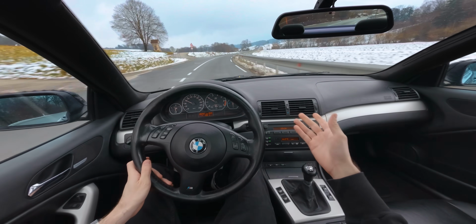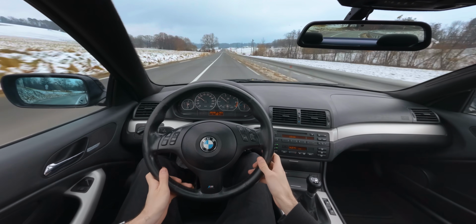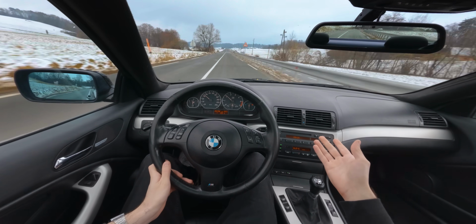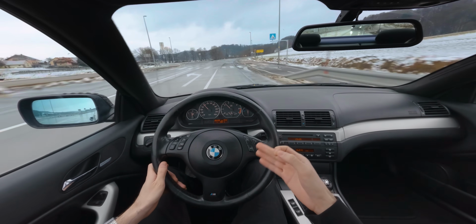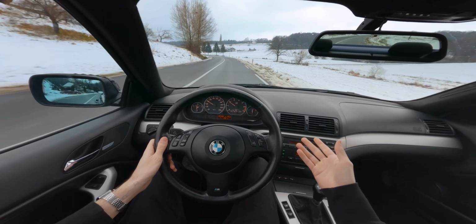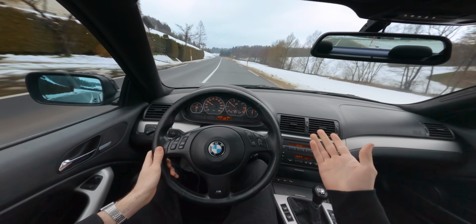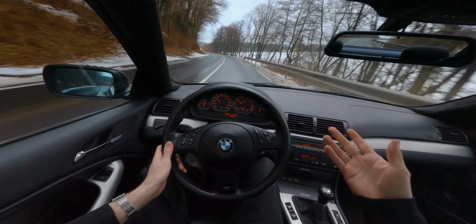You won't really hurt the car, but it will feel a bit sluggish and not as playful, as with 205s for example. If your primary goal is looks, then it's okay, but just be mindful that those wider tires will take away from the experience. Your car will handle and have more grip in high-speed corners, but everything in between will feel a bit too much. That's just something to think about when choosing your wheels and tires.